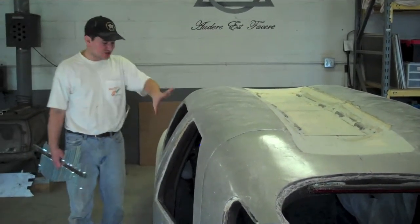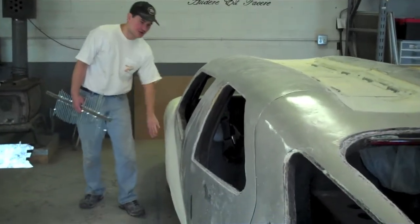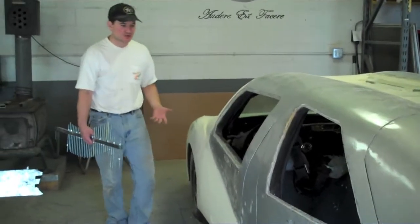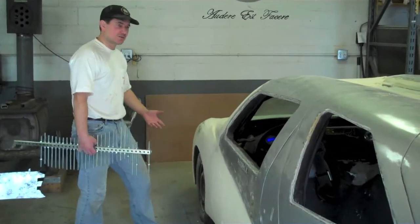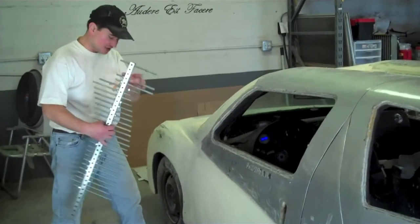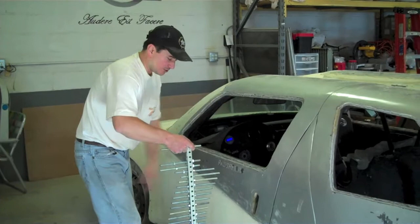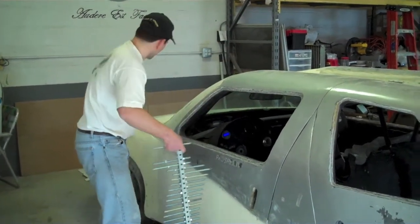Coming off the side of the car, you can see we've also trimmed down the side curve — we've raised it up. Some of the mistakes we made along the way: we're in a small shop and we've never done this before. We got back from the car and said it needs to be bigger, so we added to the side of the hump instead of adding height to it. Now we're getting it trimmed down and matching up both sides using these tools — going down the car every six inches, making a vertical line, adjusting the tool, comparing it to the other side, then shaving and sanding it down.